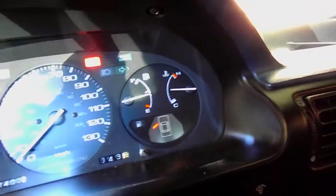It's already been past five minutes and still no cooling fans at all. I'm going to try the fan timer right now. I just put the new one in and still no difference whatsoever. For some reason it still reads about warm, and it's been about 10 minutes. I guess we can classify that as a no.